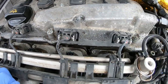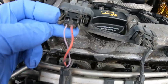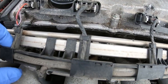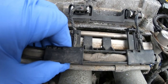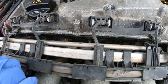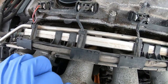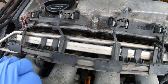We've got the four injector harnesses out. This one I'm probably going to add some tape to — not sure why it doesn't have it, but that's okay. If you take a look, you'll see these black tabs attached to the fuel rail — you should be able to pop them off to get better access to the rail, because there are some 5mm allen bolts holding it in place.